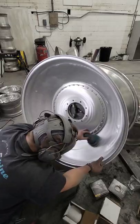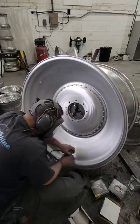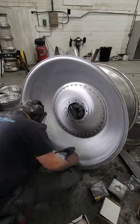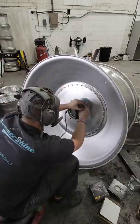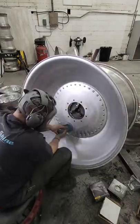We sanded this thing starting from 220-grit sandpaper on the high-speed rotary, and then moved on to 320 on the random orbit. That's going to smooth out any kind of waviness caused by the high-speed rotary sanding. After that, I switched back to 400 on the rotary high-speed.